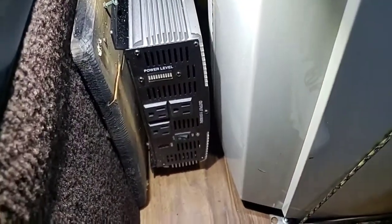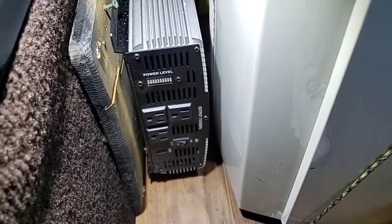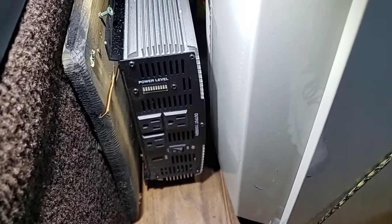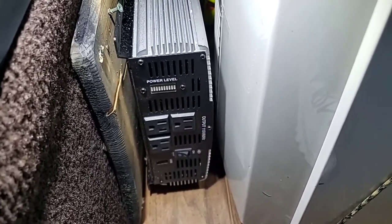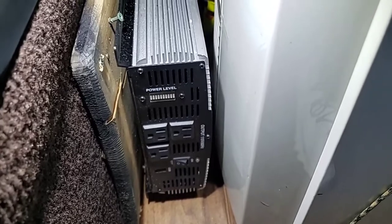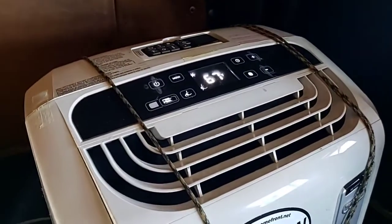The compressor will kick on but the fan kicks on right away. Here's the inverter — that's going to be power from the semi's batteries, DC to AC current. I can charge my phone at night with the truck off. That's the whole advantage to the system: the truck does not have to be turned on for the AC and the heat to work.